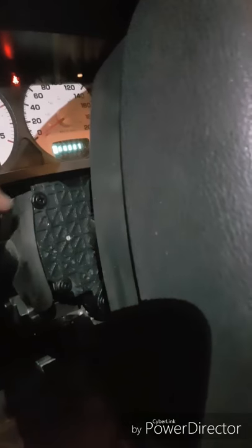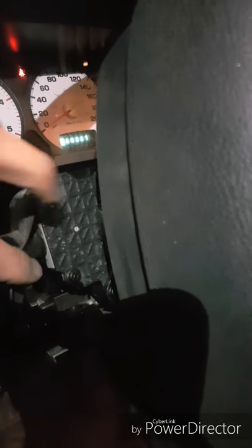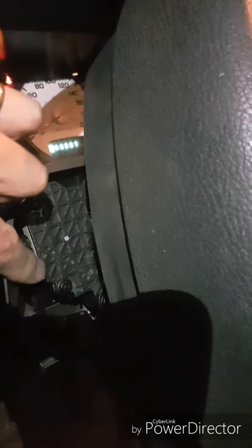Make sure your steering wheel is turned all the way to the left so you can access these two Philips screws here. My headlamp is creating a shadow. You can see this tab is all that's holding this in once these screws are removed. Just get a screwdriver under this lip here and then the whole thing slides out, as long as you have disconnected the power here — it just pops back and pops out.